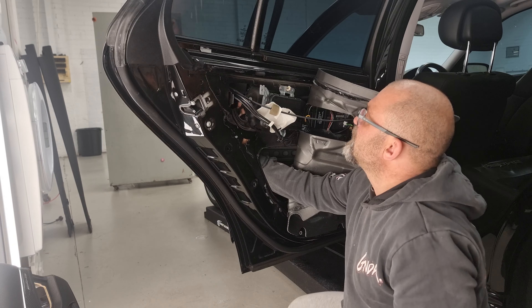So once we've done that, what we need to do is remove a screw through here. Just in here there's a little hole and you'll need to put a T20 in there, but you'll need a reasonably long one because the standard ones don't seem to fit - I've had to find a set to actually reach the back of the handle here. The tool I'm using is a T20 with quite a long bit, and I've got that connected to an extension with a little ratchet on the end of it.